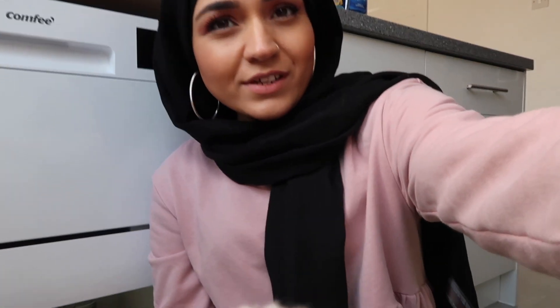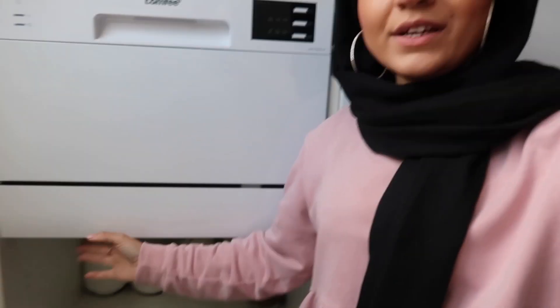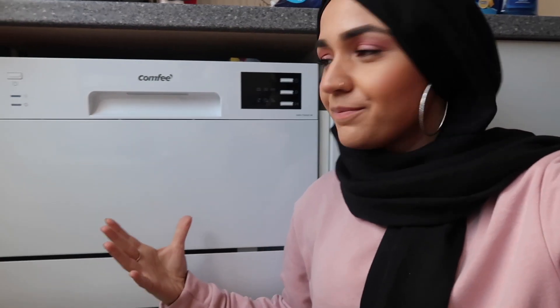If you don't have a lot of space in your kitchen, my friend has actually put it in this space here — it used to be a cupboard. She's taken the cupboard door off and put it into this gap, so it's literally the size of a kitchen cabinet. It has a water supply and waste pipe over here, but you don't need to put it there. You can put it by your sink, put the waste pipe going into your sink, and connect it to your tap as the water supply. She has used a connector to connect it to the water supply, which I will link in the description. You don't need to connect it to anything in the wall — no pipes or anything like that. You can literally just put it next to your sink and connect it to the tap using an adapter.